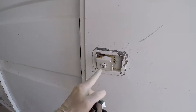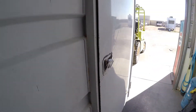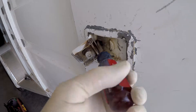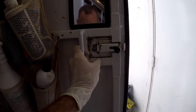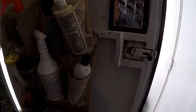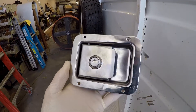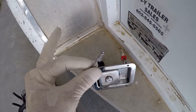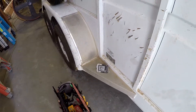I think it fits — we'll find out. It looks like it's kind of welded in place; you can see it's been tried to be pried out before. The latch still works, so rather than trying to put it back in place, I'll just use a screwdriver to get it loose. This is the back side of it — you got the handle on there just like the new one does. I just have to get this thing out and put a new one in with a stainless steel finish, because it looks a lot better and I won't be able to match this oxidized paint. We'll pop rivet it together with stainless steel pop rivets.